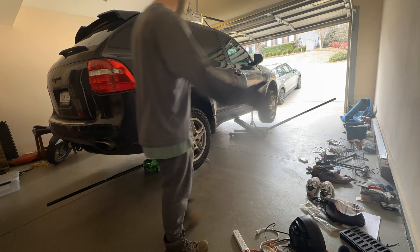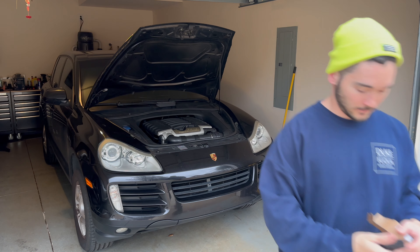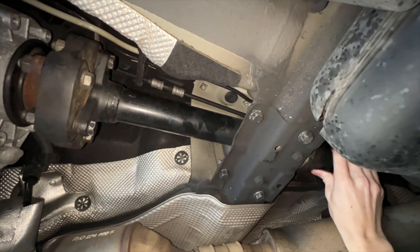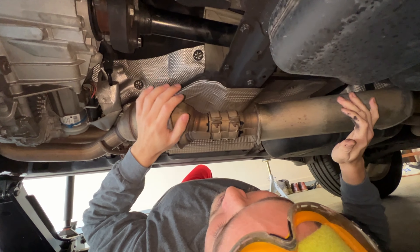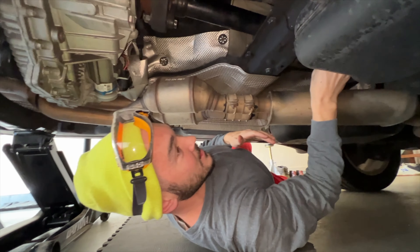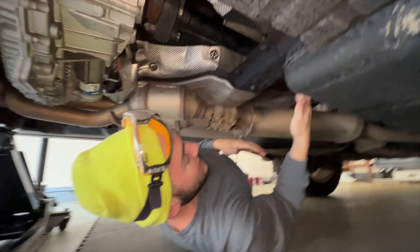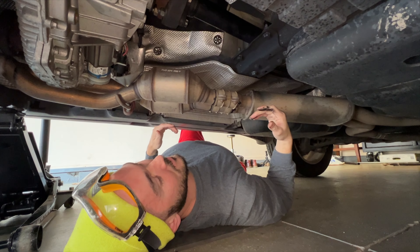Results. I am impressed with the overall quality of JXB, from the packaging to the part. I'm really happy I upgraded mine and realized that my carrier bearing support was failing for a long time. I had never checked because I thought the issue was limited to V8s, and I was very wrong. I recommend checking yours and trying to shake the driveshaft from below to see if your carrier bearing support is on its way out. I hope this video helped — if it did, consider liking the video and subscribing. Thanks for watching.